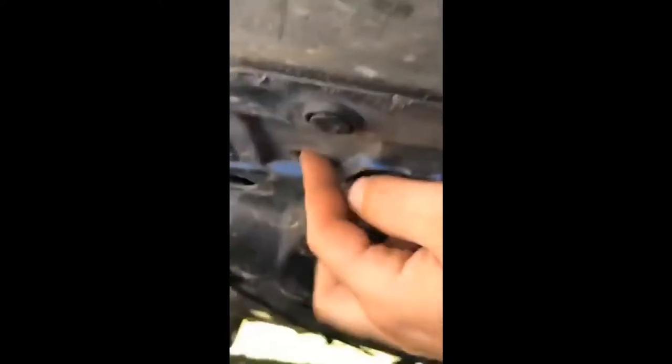Okay, I got all these clips out. I took out that 10 millimeter bolt on each side, and the clip in the middle unfortunately ended up breaking on me. If a clip breaks, use pliers and screwdrivers to get it out. What you should end up with is that the black bumper should have a lot of movement — pretty much all the way around — meaning the bumper is now free to come off the car.